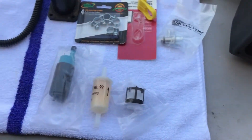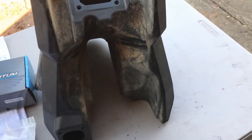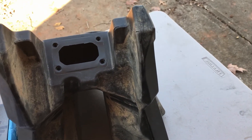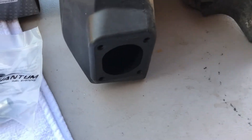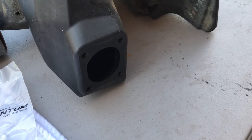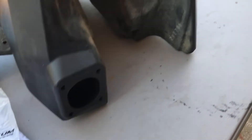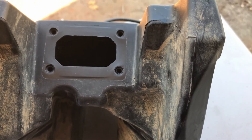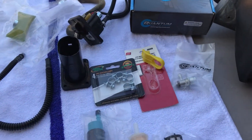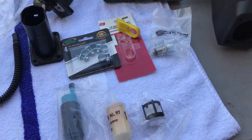To replace it, you do have to pull your fuel tank and you'll need to clean it. On the 2011, both sides have to come off. On the bottom — sorry about the lighting — this is where your actual fuel pump sits. It makes sense as it's the lowest part of the tank, and this is where your discharge, or what feeds the engine, comes from.